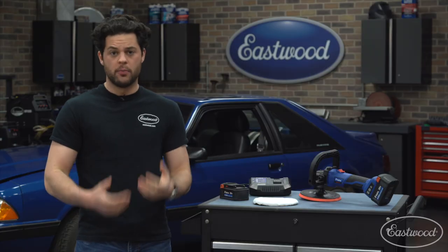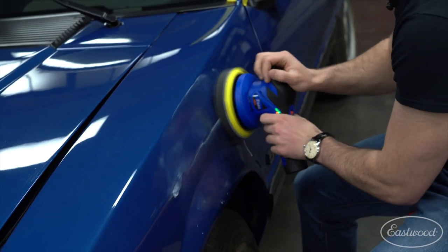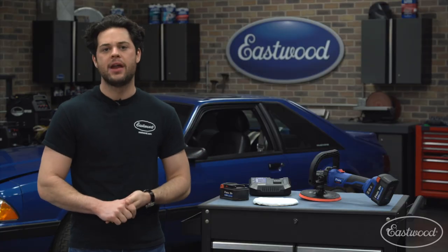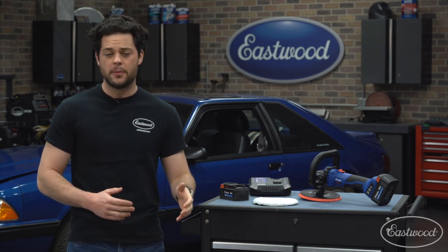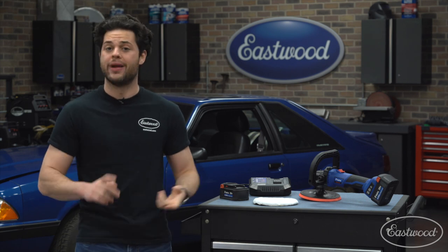There are two smaller options. There's the 6 inch DA polisher, which is pretty much your middle ground — great for polishing an entire car, giving you a good balance between quickly tackling the big panels while still being capable of reaching into some of the tighter spots. If you really want to get into those tighter spots, there is also a smaller 3 inch pistol polisher available — great for door sills, little recesses in front bumpers, headlight restoration, and motorcycles as well.